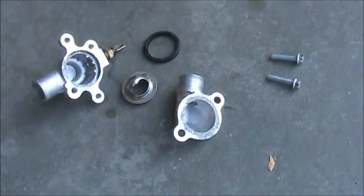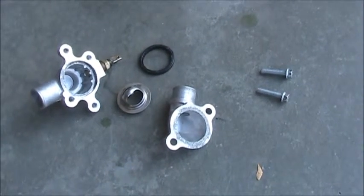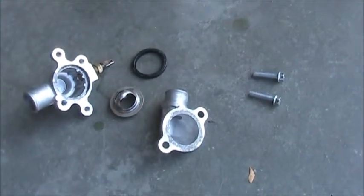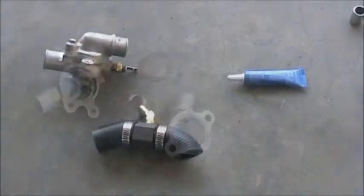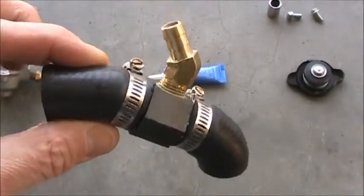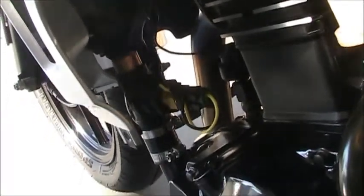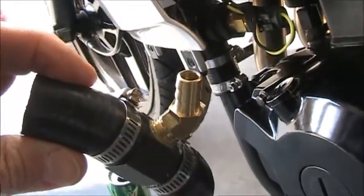I'll use a little blue Loctite. On the EX250 with its high RPMs, the vibrations cause every nut and bolt to try to back out — from the engine mounts down to the fairing bolts — so I'm a great believer in blue Loctite. It took a lot of trial and error, but this is the configuration that's going to fit on my motorcycle. There will be some variation in other people's installations, and mine is different mainly because of the fuel injection coolant temperature sensor. I'm about to finally install this and then move on with the bypass line.